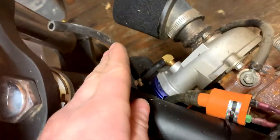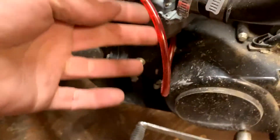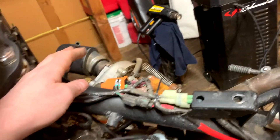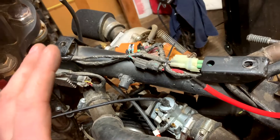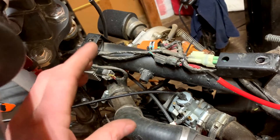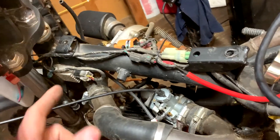What was going on is the fuel tank itself - the way I had it plumbed - there's a T coming off the output of the intake side of the turbo, and one side goes down to the carburetor, pressurizing the carb using boost pressure. I was also using boost pressure to pressurize the fuel tank as a means of making a fuel pump. It would only be effective when the tank was full of gas; around a quarter tank it would start running lean, run like crap, and stall out when I let off the gas.